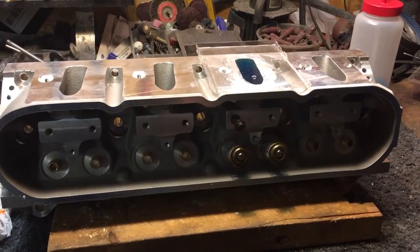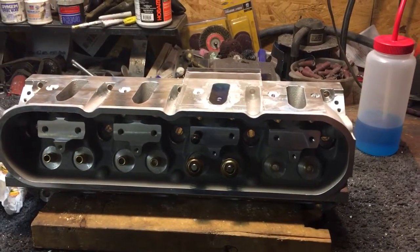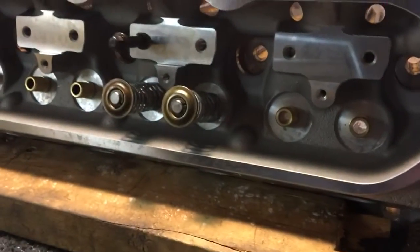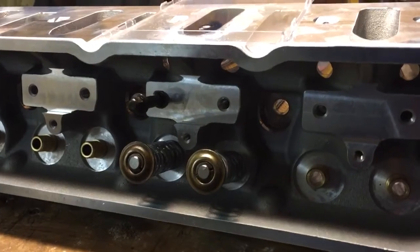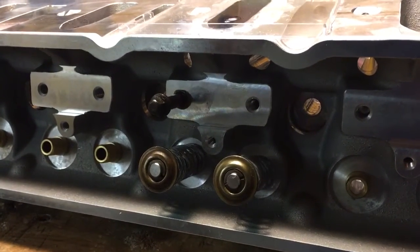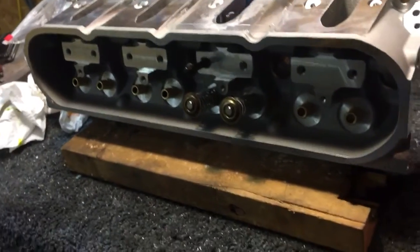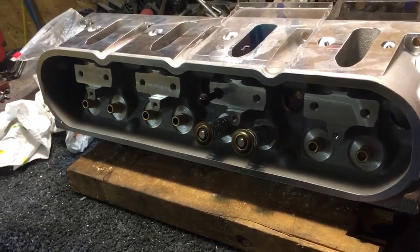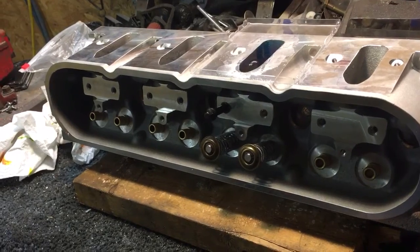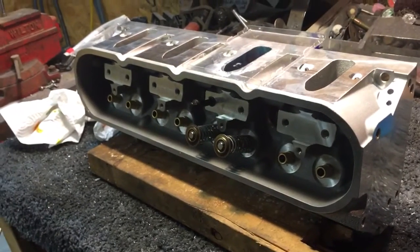I want to do a little update on this process — these All-Pro cylinder heads. I'll recap how you set them up before you CC them. On heads that have been ported, or particularly these aftermarket heads, you have to put your rocker arm bolt in that hole with a little bit of Vaseline to make sure you seal that hole that pokes into your intake port. That happens both when you're porting a set of heads to be a 215cc or bigger port, and apparently on these aftermarket as-cast heads that rocker arm bolt hole protrudes into your intake runner.